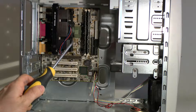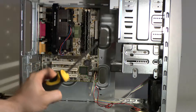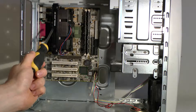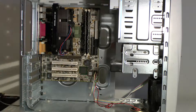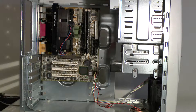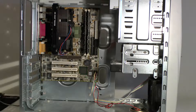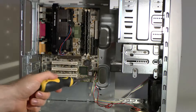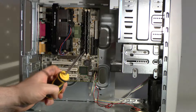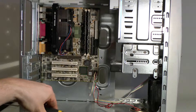This is an AMD motherboard with what's known as a Slot A processor. The socket it's inserted into is the reverse of an Intel Pentium 2 or original Pentium 3 style cartridge processor — Intel called it Slot 1, AMD called it Slot A. This particular motherboard has PCI, AGP, two positions for RAM, and IDE. There's no SATA on this because it's too old.